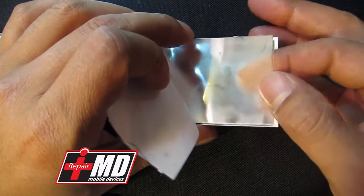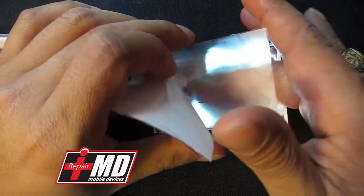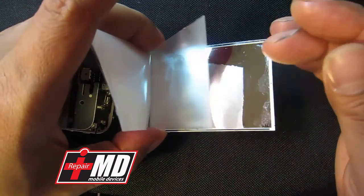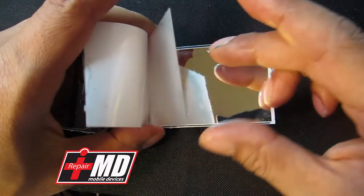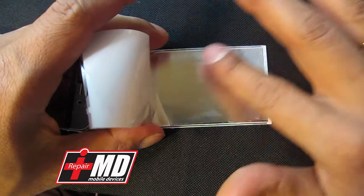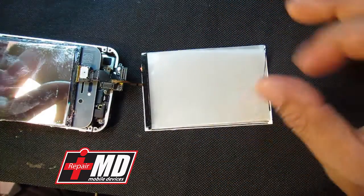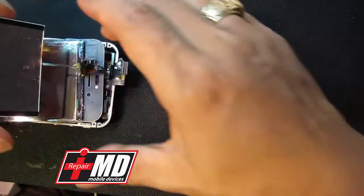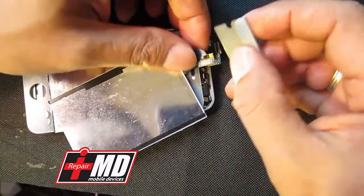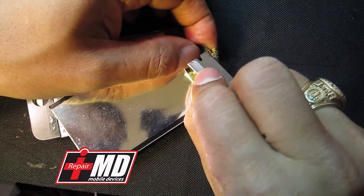For an iPhone 4, it won't be worth cleaning all these individual pieces. But I know how it is to find parts for an iPhone 5 — for an iPhone 5, it's probably worth your time to go and just clean each individual layer with an alcohol rub and assemble it back. For an iPhone 4 or iPhone 5, if you do have the spare backlight, all you have to do is swap it out.